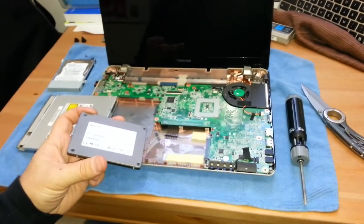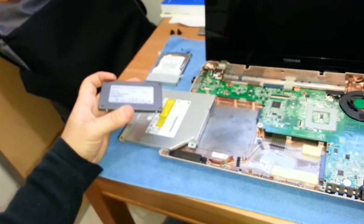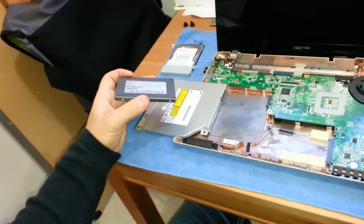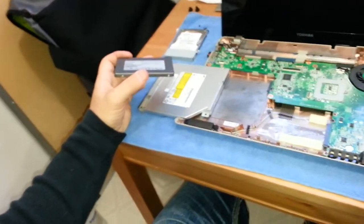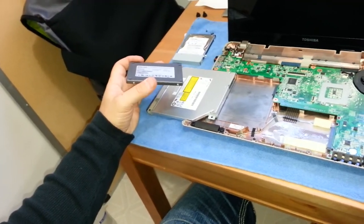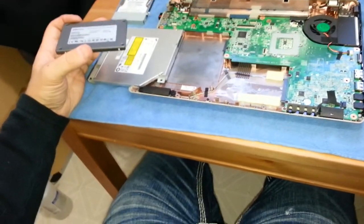Of course, I'm going to have to reinstall Windows, and I do have reinstall disks, and I'll have to download some drivers from Toshiba. Actually, what I like to do is copy the profile from this 500 gig drive over to the new SSD drive. I copy the entire user profile, my profile, and that includes system files. In that profile capture that I pull over to the new operating system on this Micron drive, reside some drivers, and I'll have all the drivers basically installed automatically. When I drag them over to the computer, there's a few of them that you have to manually install. Wireless, I think. There's some keyboard shortcuts. The DVD button on the function side of the keyboard up on top, there's a DVD release or eject button that you have to install drivers for specifically from the website. But anyway, other than that, this is a pretty easy swap out.